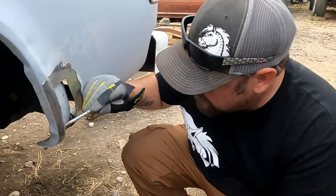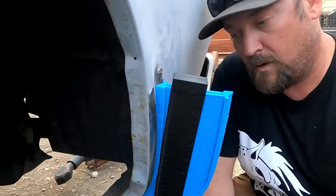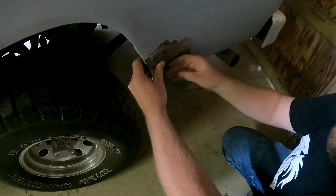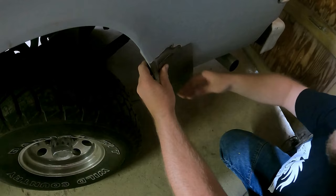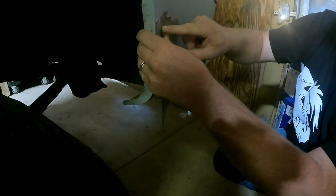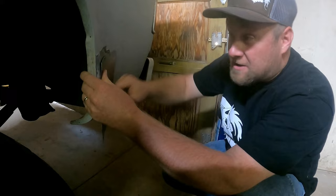I can fabricate my panel to about the same shape, marking out spots we're going to cut out where it's real thin metal. Contouring to the other side going this direction, I've just got to make this curve that way. So fitting this patch — we've got our curve this way, and now we need to bend this down into the bottom. I've got a line here where we're going to start our bend and hammer that out.